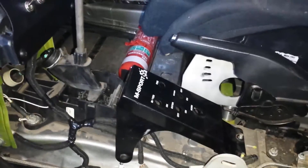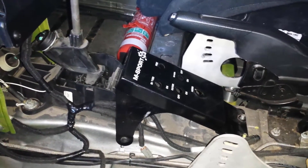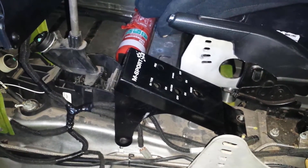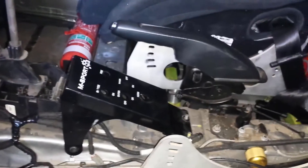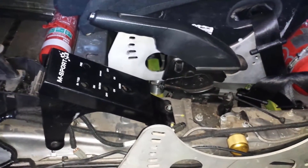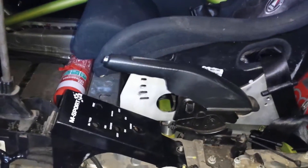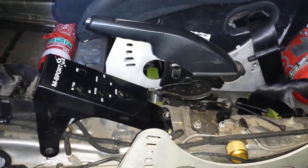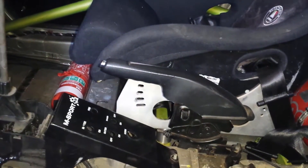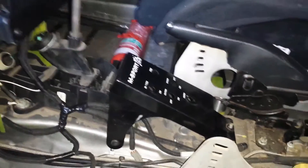What we're doing for the customer is some upgrades to bring it up to Australian PRC specs — you could say like a Group A or maybe a quasi R2 spec. The first upgrade the customer wanted was a hydraulic handbrake. The positioning of the factory handbrake, which is cable to drum brake rear end, wasn't ideal. The position's not very good for the driver to grab hold of the handbrake when you need to do a handbrake turn. So he's asked for a hydraulic handbrake — a drift-type, vertical handbrake instead.